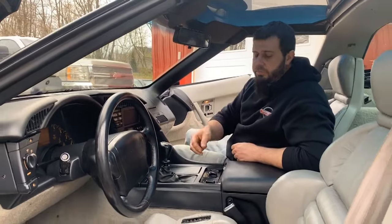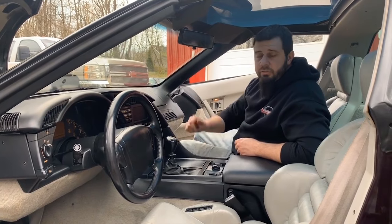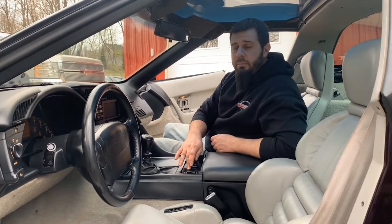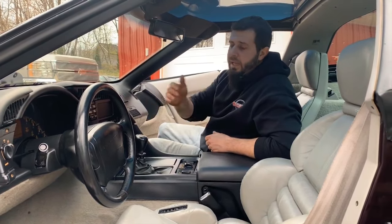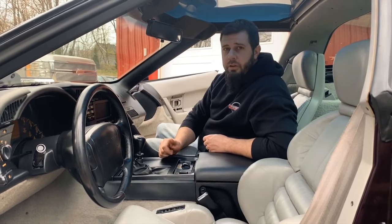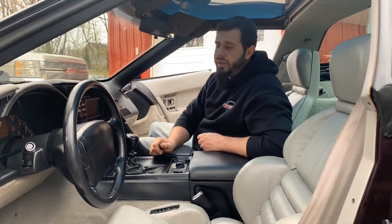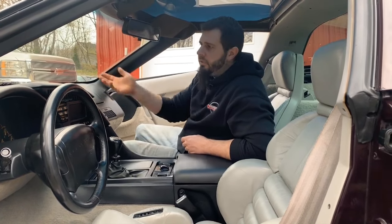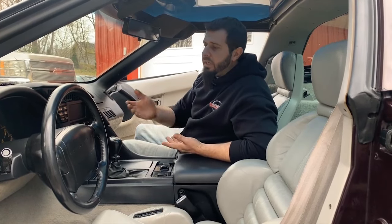Other than that, there are just a few more interior differences. You have sport seats and a ride control selection switch in the middle of the power seat switches. A few 92 ZR1s had a driver side only power seat switch option with manual seats on the other side. Your climate control — some very early 90s had a manual climate control instead of automatic, but most ZR1s have automatic climate control. There is a programmer that controls the climate control that is specific to a ZR1, and the interior wiring harness throughout the dash is specific to a ZR1 so it has the connections for the additional valet key. Sport seats and FX3 were also options on base models.